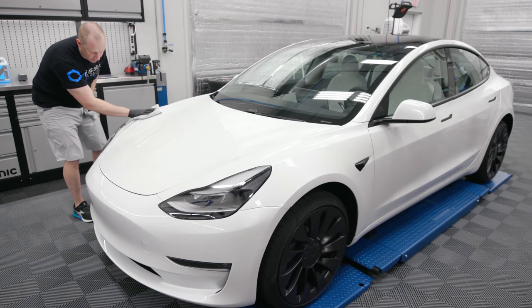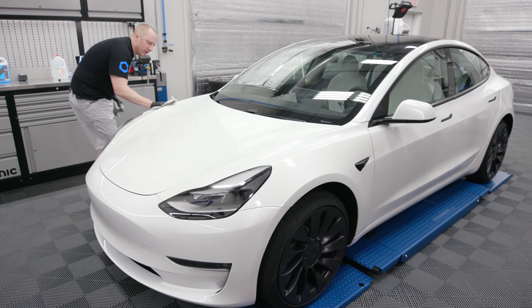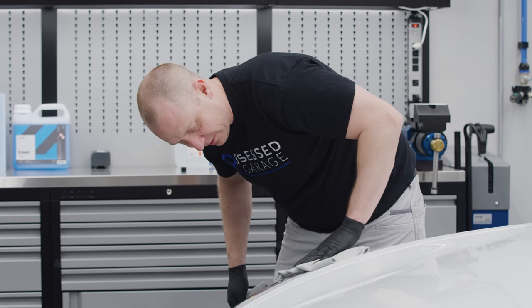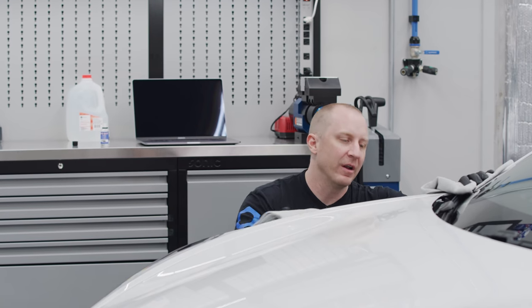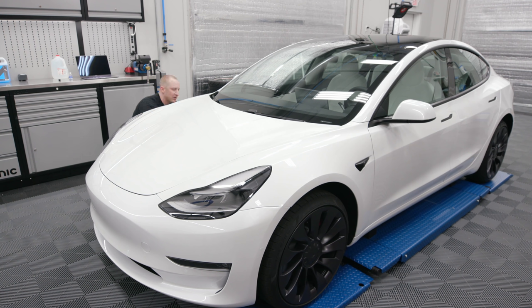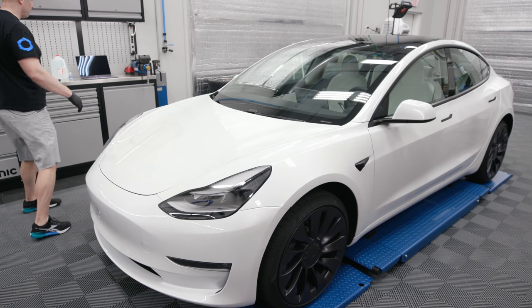You can see I'm going right over the headlights — be careful with headlights because we talked about this: you can't polish the headlights. Make sure you don't end up with any high spots there. If you polish the headlights you're toast — you'll blow through the clear. You see headlights that are hazed over and yellow — you can temporarily fix that, but once the UV coat is gone it will never look the same. You could re-clear coat them but they're never going to be as good as when they were new.